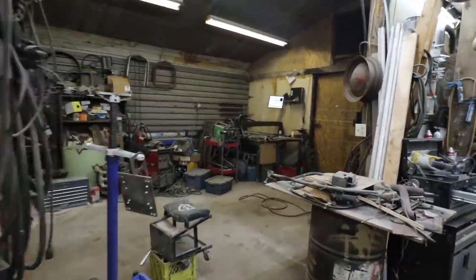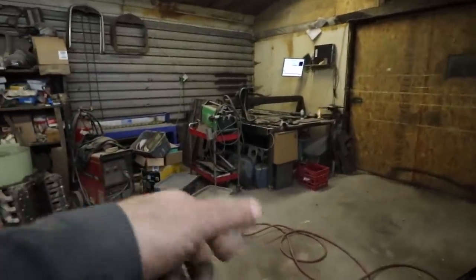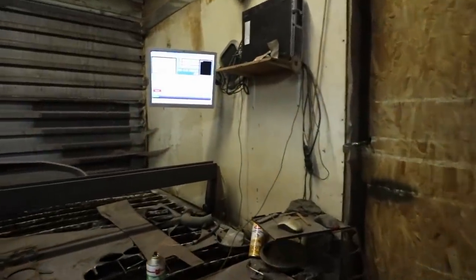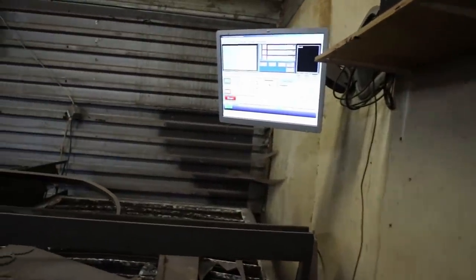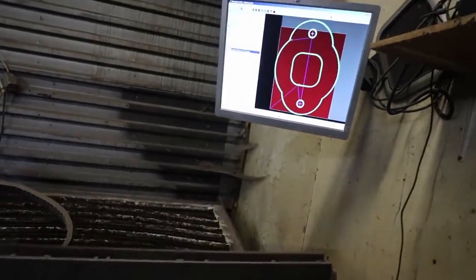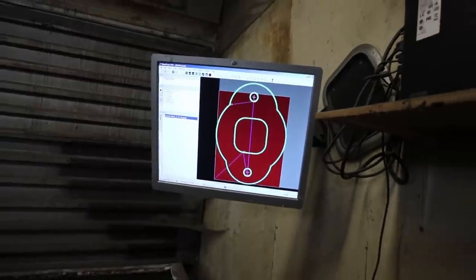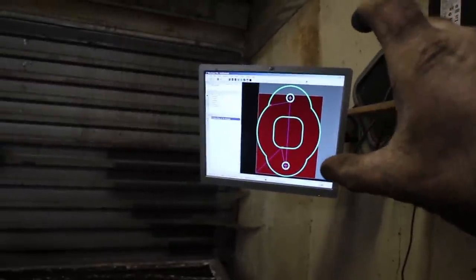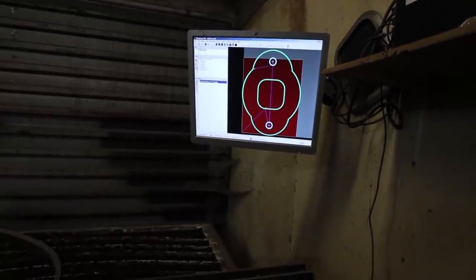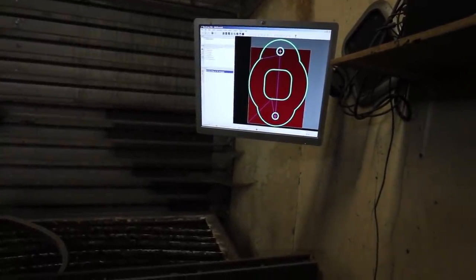tab I've made. When I had a first gen, I had one of the twist lock slave cylinders, and the sucker just blew a hole through the firewall on that particular truck. So I made this, which is super simple, but the twist lock goes in and then you can bolt it in on top and bottom. So it should work perfect for this application. So pretty much we've spit that out.